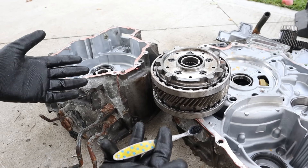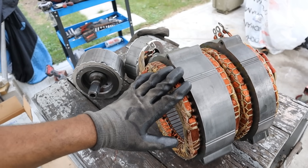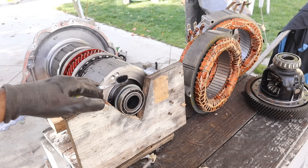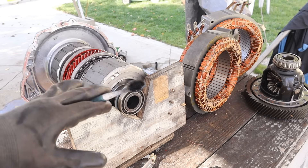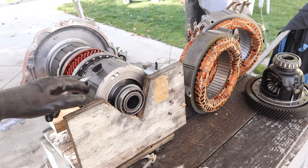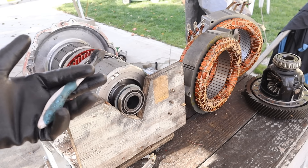And that's a testament to Toyota's ECVT for reliability. It is worth noting that all of these motors and gears are fully covered in automatic transmission fluid to keep them cool. Automatic transmission fluid is not conductive, so it won't bother the coil. And that's a wrap on the electronically controlled continuously variable transmission and how it works. I think these hybrid systems are actually fairly solid and reliable — probably even more so than a manual transmission — and they've proven themselves to last a long time. Make sure you support me on Patreon and subscribe if you want to see more videos like this one.